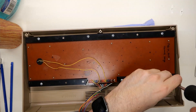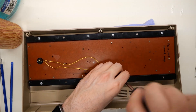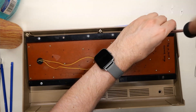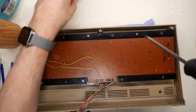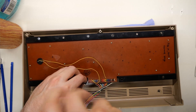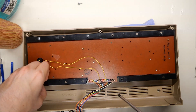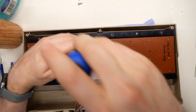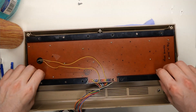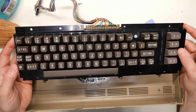One of the reasons why I leave it in this ZIF64 case is it's very clean, but I also really don't like the way it feels to type on. It's a lot mushier feeling than all other 64 and VIC-20 keyboards I've typed on — the ones with springs. I think that has to do with the way the rubber domes are. So it sort of stays in this machine, which is a bit funny because I end up using this computer a lot — probably the most used Commodore 64 I have — and yet I put a keyboard in it that I don't like.